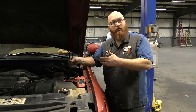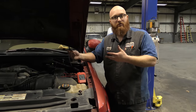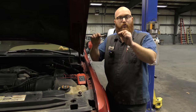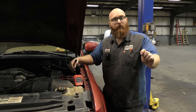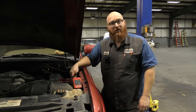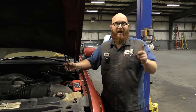Everything should be .01, .02, somewhere around in that range. When you come across one with this tool showing .3, .5, 1.5 — you have found where the draw is. Then you look up online or in your service manual what is on that circuit. Is it parking lamps? Is it power seats? Is it the radio? From there you can go to only those items and deduce exactly what's going on — unplug the radio, come back to that fuse again, and if that draw is gone, boom, you found it. A bad radio.